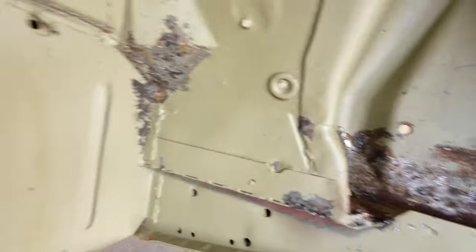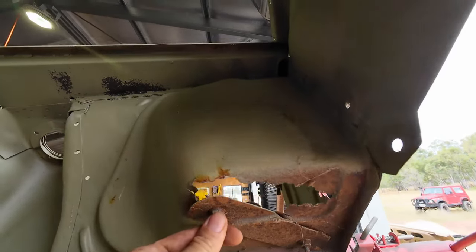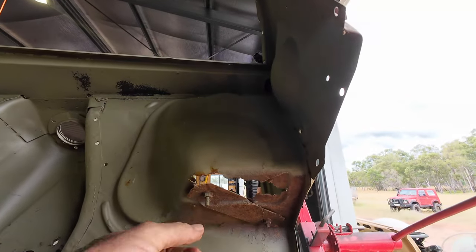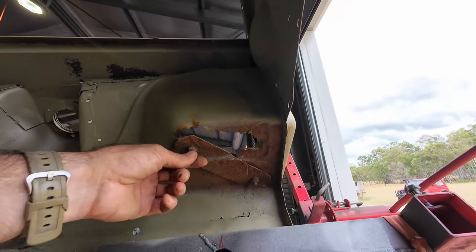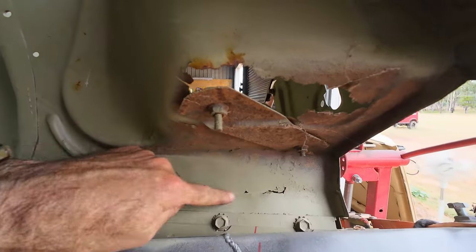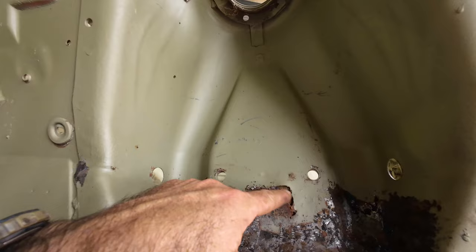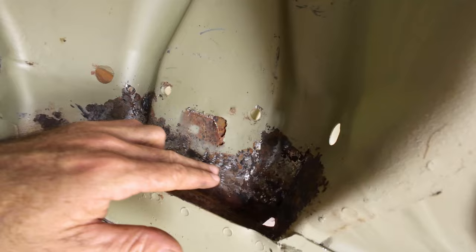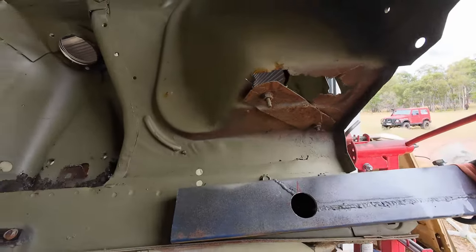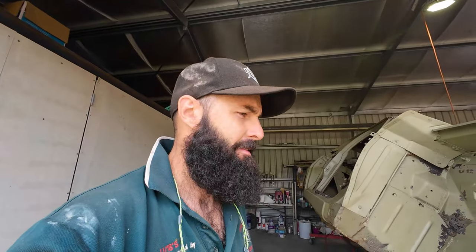You can see the air chisel worked pretty well - cleaned off all that tarry stuff they put on there. This is a better look at the rust repair under the battery box section. I'm going to take off this plate, repair that bottom section, and if it's no good I'll remake that plate. The bolts are all rusted off anyway so I'll probably cut it out. There's another section here to do and a little bit where it ripped out from my dodgy makeshift bracket. The bottom looks pretty good - fresh steel there from factory. So pretty much three sections to do, then I can seal this off and paint it black. That's the motivation piece - that's about half the car done.